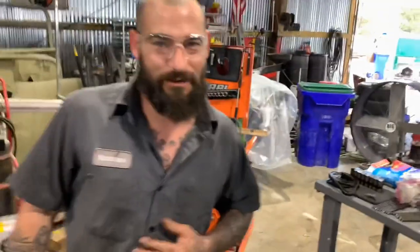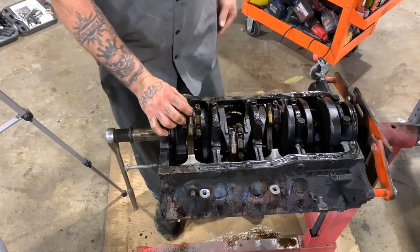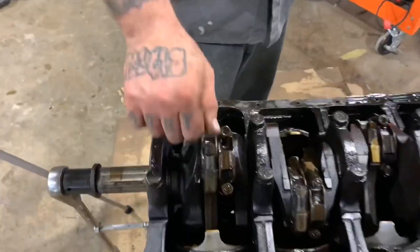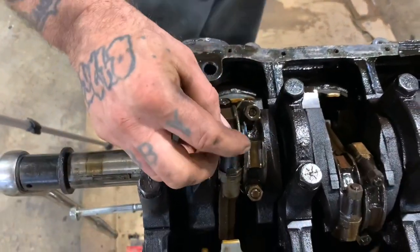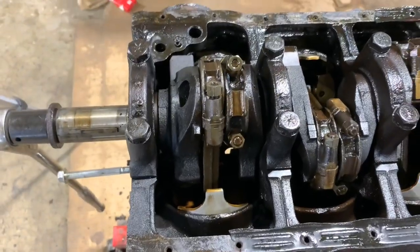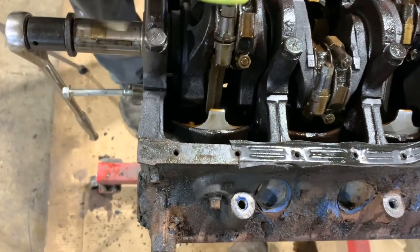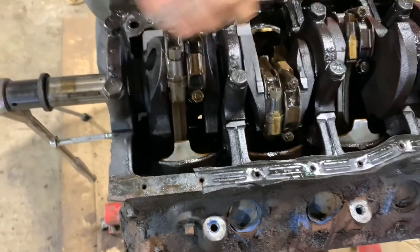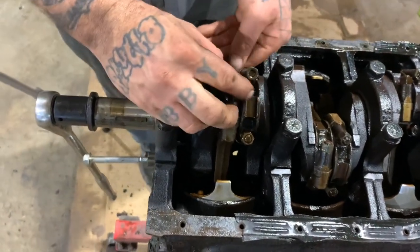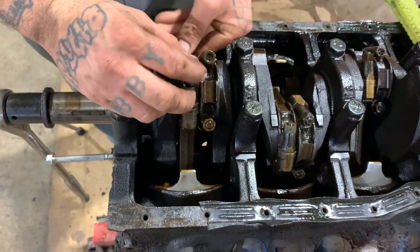I know you want to turn some wrenches, brother. All right, so we're going to pull the pistons out and the rods. Austin already loosened them up. It's a half inch. Loosen them up to about right there. What I always do is take a brass hammer or a dead blow, whichever one you grab first in your toolbox, and hit it right there and knock it down so that is easier to get off, or be stuck on there. And then take your nuts off.